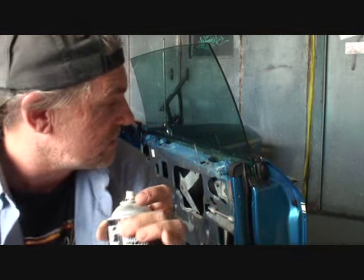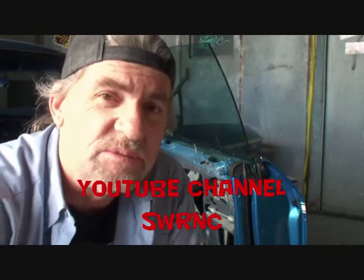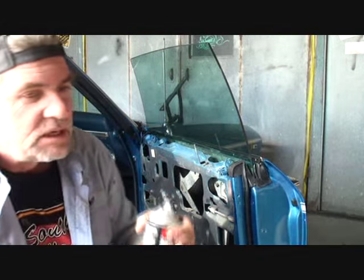Let's get this paper back on — this is real important. This paper is a wind guard; it's also a guard for debris and moisture getting into the car. Let me show you how to install that the easy way so we can get this door panel back on. If you don't have any paper, go to your local hardware store and buy yourself a small roll of ABS plastic — it's got to be pretty thick — and then make your own. I have videos on the SWR YouTube channel and DIY Auto School showing how to make wind panels for your door out of ABS plastic.